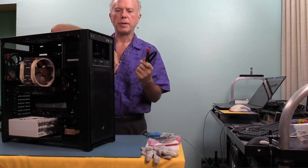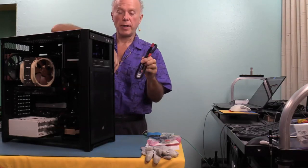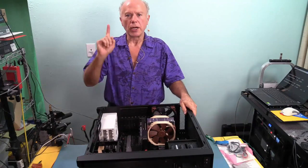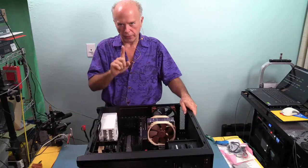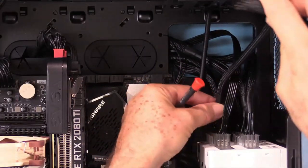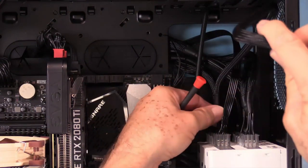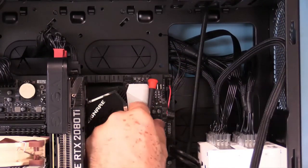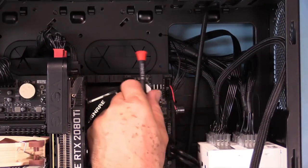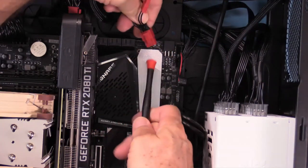The reason I mention that - we don't have the PEG connector, the PCI Express graphics connector, which is the extra power tap to the motherboard. We're going to do that right now. Looking at the overhead - right there's our PEG connector. We've got our power tap installed, coming off the same leads: one and two on top, and this will be number three - so those three are right in line out of that block. The notch for the lock goes up, so we'll turn this around. Routing it out and back in.